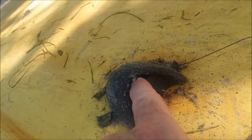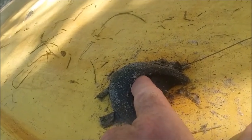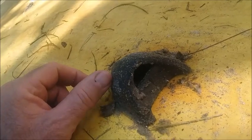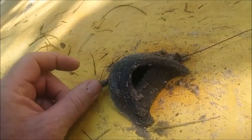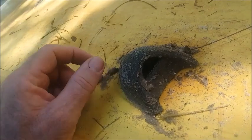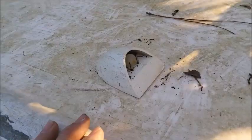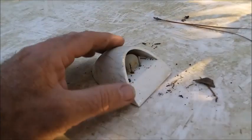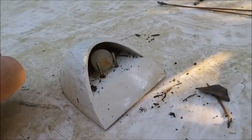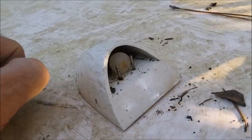There's typically a ball up in here, which when the boat is not moving, it floats back up and makes it seal off so that it doesn't backflow water into the cockpit. A lot of times that ball is missing. Here's what the aftermarket plastic drain siphon looks like — this is on the bottom side, and you can see that it has that rubber marble that works as a backflow preventer.